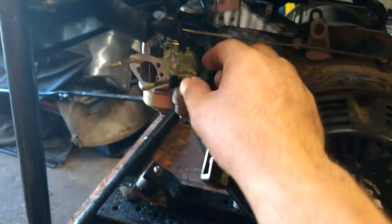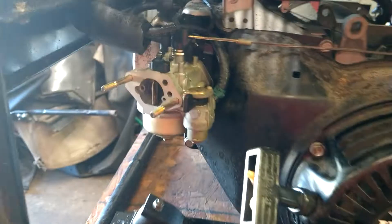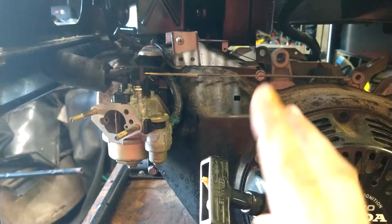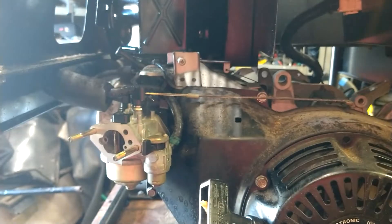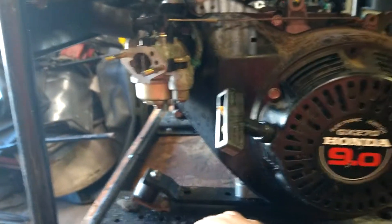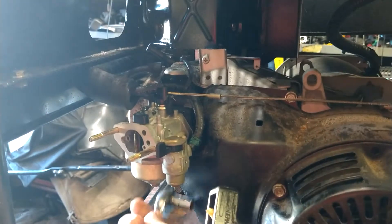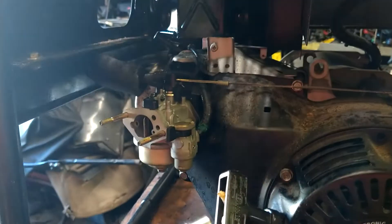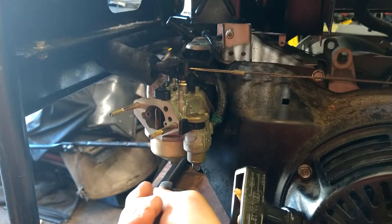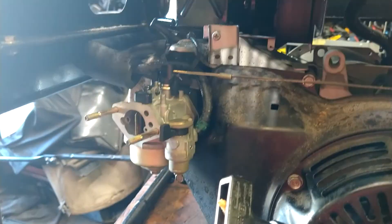Dump some gas in, make sure the fuel valve is in the on position, and check that no gas comes out of the carburetor mouth. Since we boiled everything out with acid it's very clean but also very dry, so the needle valve may stick open and leak. If it does, just tap the bottom bolt lightly with a ratchet and it'll stop dripping. This one didn't drip at all — it's fine.